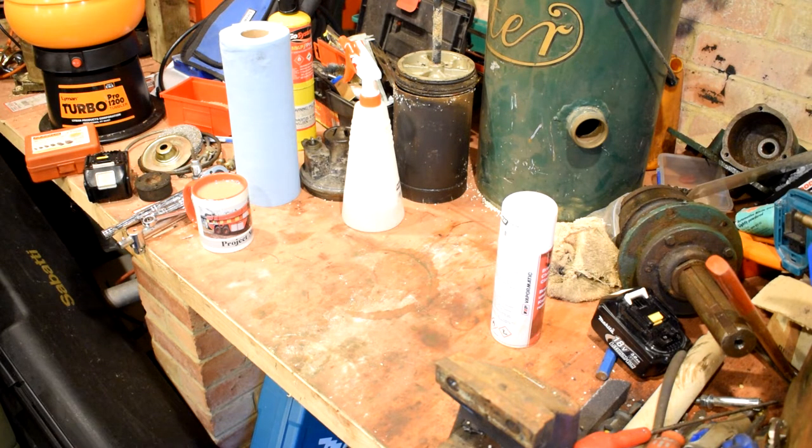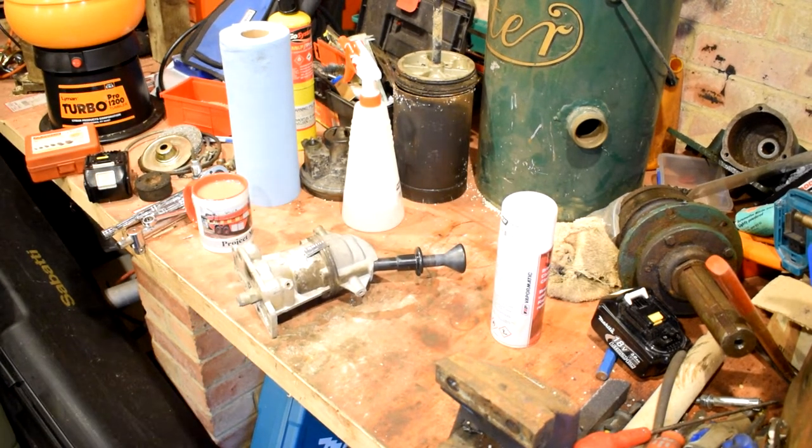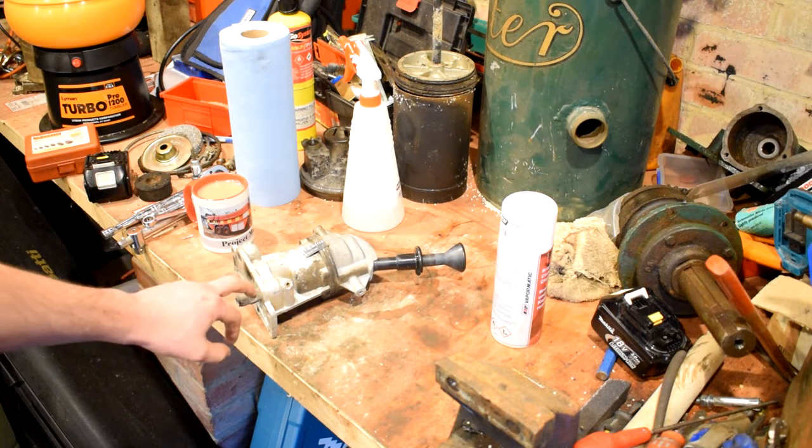One of the other spares we've been needing — we've had problems with the handbrake. The handbrake is completely unavailable; they don't make them anymore. They've been out of production since about 2007, but as well as fitting a Leyland Olympian, they also fit some Dennis buses, Bedford buses, and TK and TL trucks with air brakes. So I have a new-to-me secondhand handbrake valve.